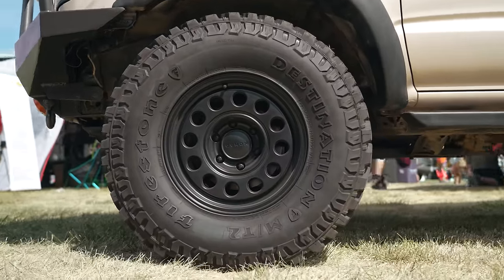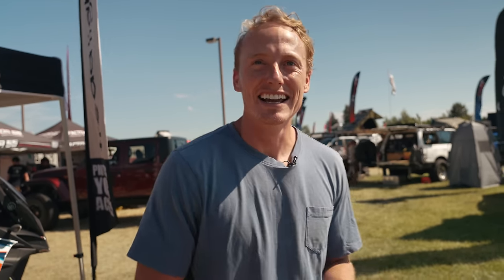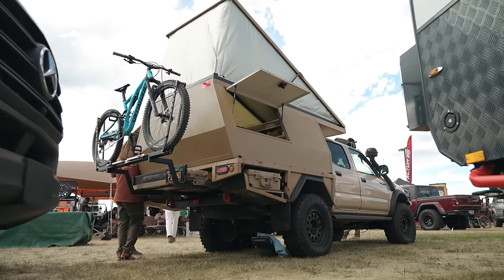What about the wheels and tires? I've been running Toyota Steelies — they came as the spare — up until about two weeks ago with BFG KO2s. Recently switched to Firestone Destination MT2s, which is my first mud terrain. Doesn't really make sense for how much road driving I do, but they just look so much better. The wheels are the new Nomad Convoy wheels, negative 10 offset, which let me get rid of the inch-and-a-quarter spacer. They're nine pounds per corner lighter than my last setup.